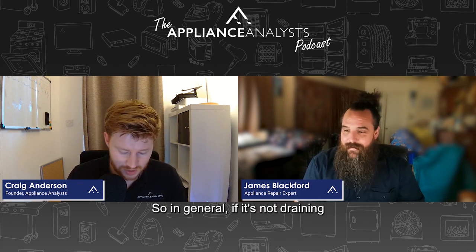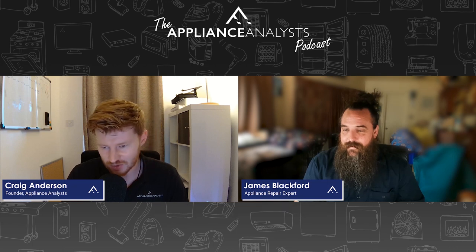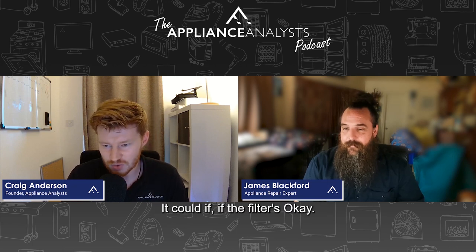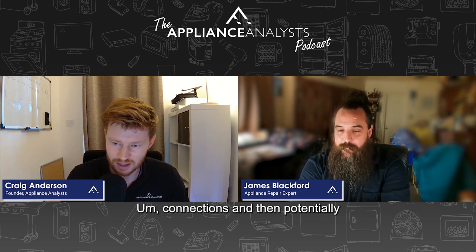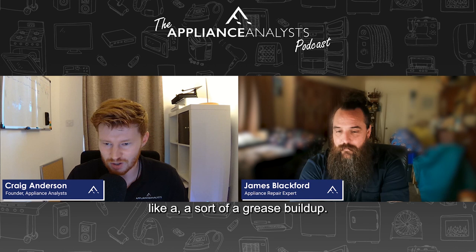So in general, if it's not draining properly, it could be just the filter. If the filter's okay, it's worth checking any garbage disposal connections, and then potentially a sort of grease buildup.